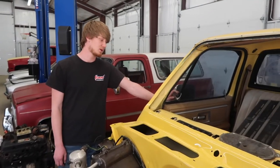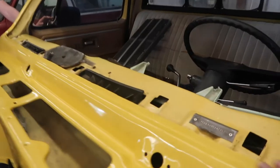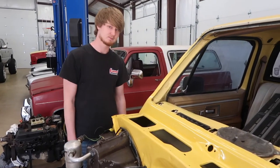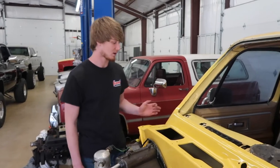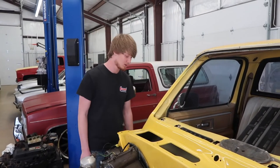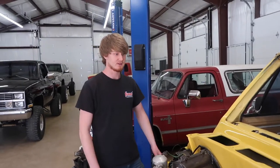We'll drop some pictures in here of what it looked like. When we first pulled it off, I just took a pair of channel locks and pulled it out. We pulled this windshield out and this whole tray right here was basically non-existent for the most part. This ends up being the worst side over here — that side was still bad, just not as bad as this side. I pulled out a bunch of chicken wire, bondo, and fiberglass — I don't know how long that had been in there. I thought it was just up at the top at first. I took a grinder and went over the whole thing down to metal, and it ends up being from pretty much here all the way over down the whole sides — everything besides this middle piece.